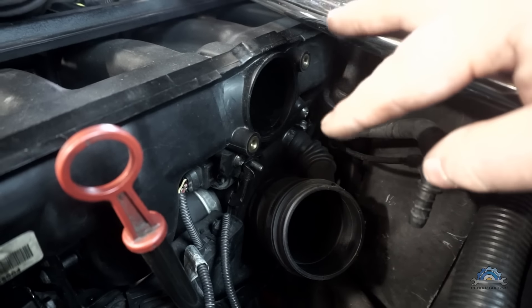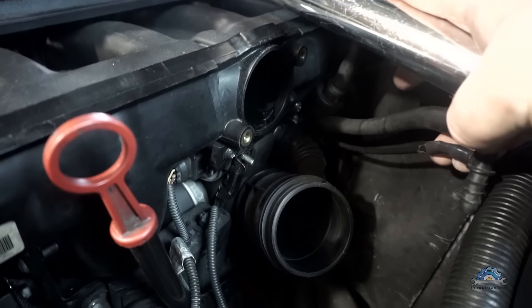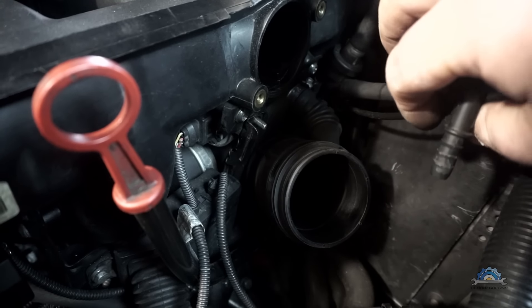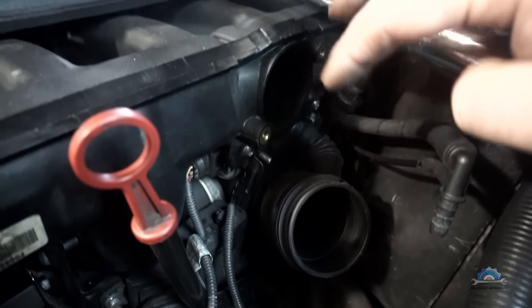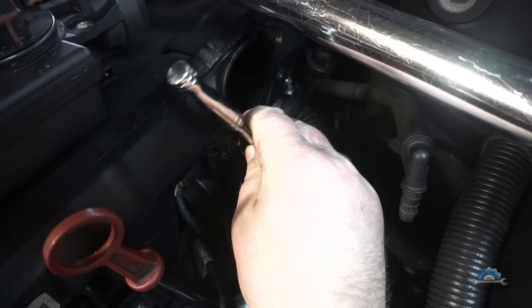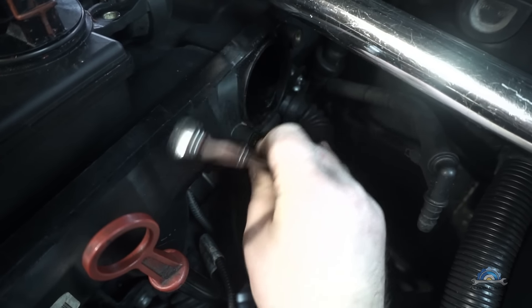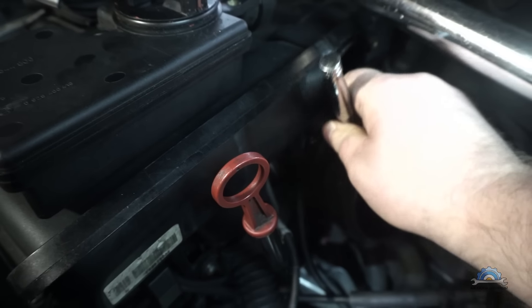I'll be explaining that more in my series of videos about diagnosing problems with this engine. I'll be mentioning that, but here you can see where it's going, so make sure this rubber hose is good — you can replace it, make sure it's fresh and not brittle or hard, because it's a very important piece of rubber. Got my spare nut for the bracket which is holding the ICV in place.